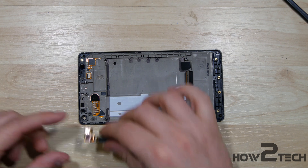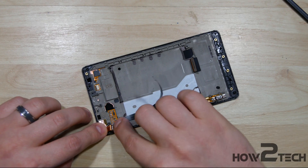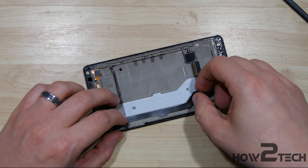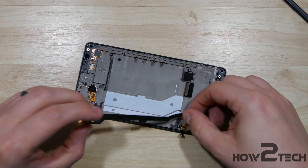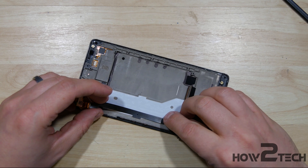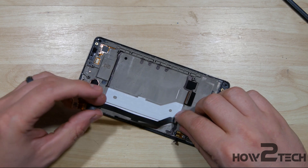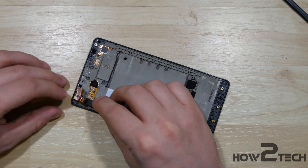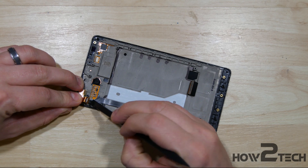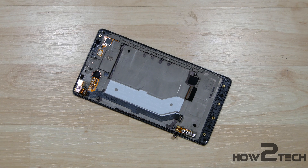We're going to start off with the front-facing camera ribbon cable here. We'll go ahead and insert it into its correct slot. We have this long cable that runs down the interior portion of the phone. You want to get this lined up on top of this white adhesive backing that's stuck to the phone, so that when we go ahead and try to reattach the cables, everything fits back up nice and properly. If you insert the cable up here at the top and use your spudger to get the cable to sit flat, it'll start to line it up and you can just quickly adhere it to the back of the phone.